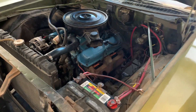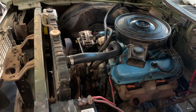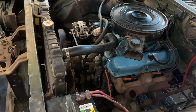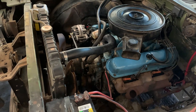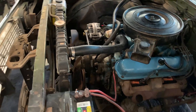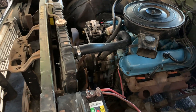I was working on it for maybe 15 or 20 minutes, finally got it to start again. And this time I heard a crazy loud knock coming from the front of the motor — the distributor wasn't moving. That little tick mark to let you know where the timing was at was just shaking back and forth like crazy. So it needs a new timing chain. We're going to drain the coolant back out, take apart the water pump and the fan, and replace the timing chain.